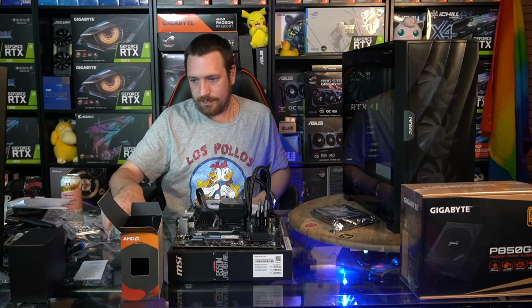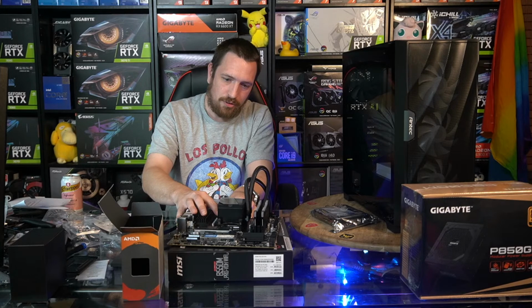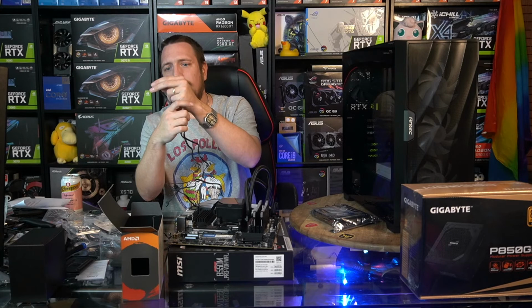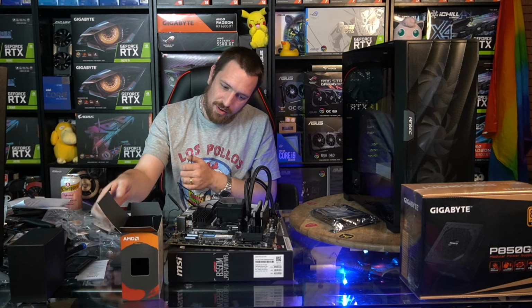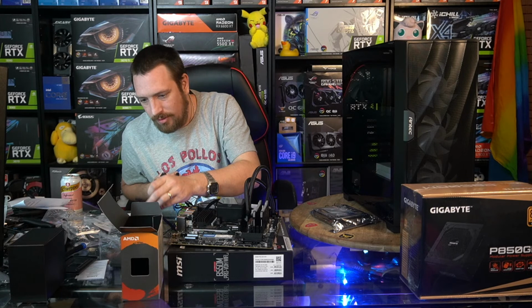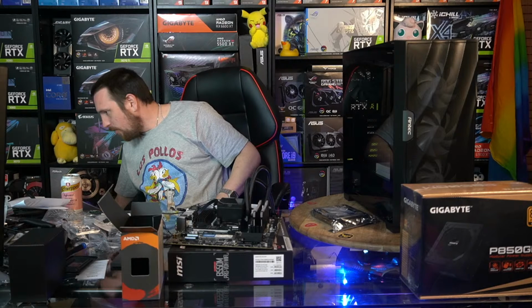Alrighty, so we just get this one cable coming off our cooler block, and that can go straight up and around the back side of our board. Now we get a pre-installed fan splitter, so we can plug one water fan power into those two fans. And then we've also got our daisy-chainable RGB connections, and they are also coming off our pump. Just to give you an idea of how that's all going to go together.